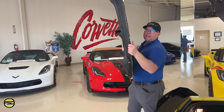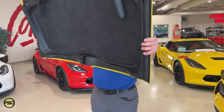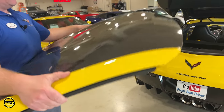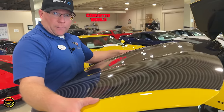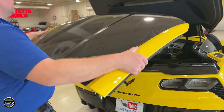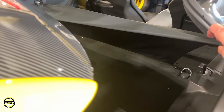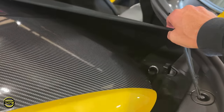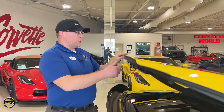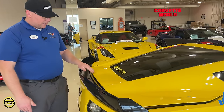Now rotate it like this. Yes, you're putting skin on the paint — another reason for microfiber towels — but you've got full control without putting too much stress on your back. It's carbon fiber and only weighs about 17 pounds, but you can still throw your back out. Go up and in over the spoiler. There are two holes on the sides and two hooks right under there. You go underneath your cargo shade and hook it in place. Then put it down. If it's a 14 or 15, just gently drop it; if it's a 16 or newer with the small takedown, you can do that.